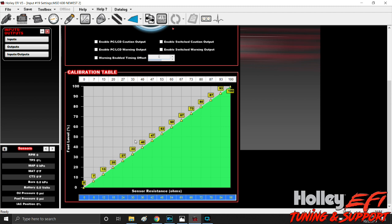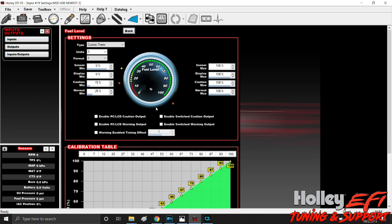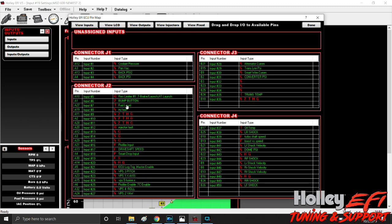That's how you start it, but for ultimate accuracy what you do is run the tank all the way down, check what it's reading — that should be zero. Then start adding fuel: if you've got a 10-gallon fuel cell and you put five gallons in, your 50% number should be right in the middle at whatever resistance the sensor is giving you — check with a meter or live-view it in Holley's data. Then work your way up to a full tank at 100%. For pre-canned numbers, use 0 to 90 ohms mapped to 0 to 100%.